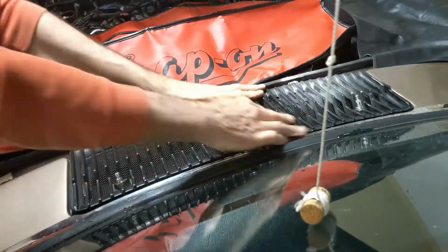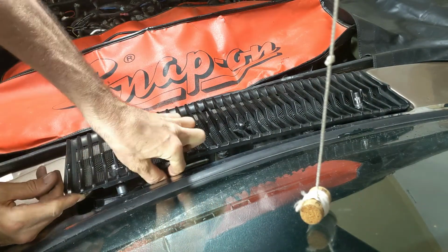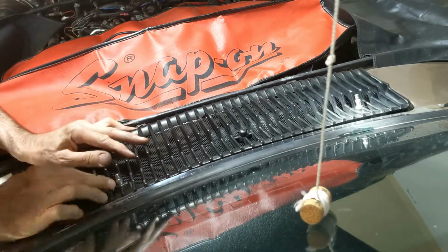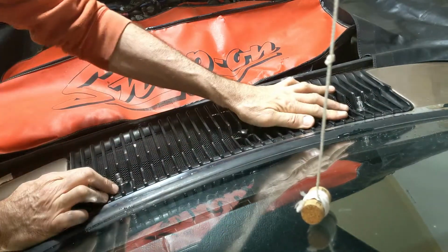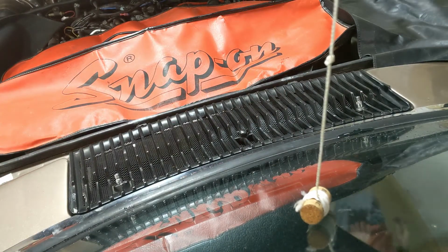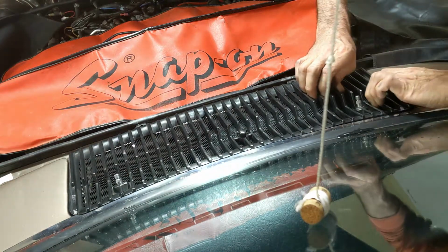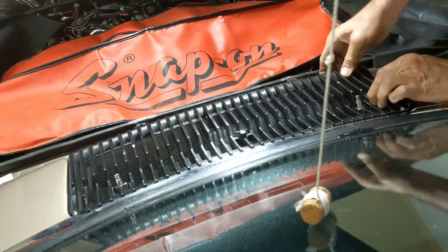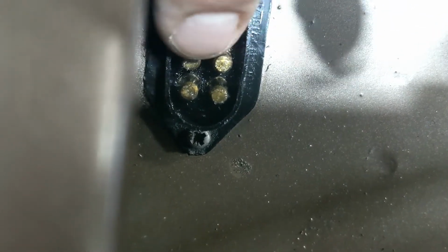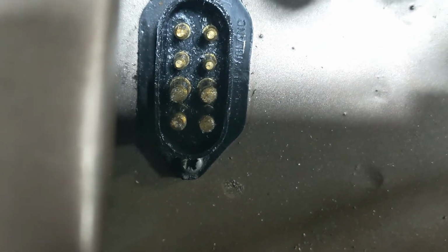There. Bloody hell. Oh, have I broken that thing? I've broken it. No, not completely. I think that would be fine. There. It's in. I think. This one's not quite on. I've got the wire wrapped around. It's this one and this one that should short, i.e. close between those two terminals in the off position, thus parking the blades, and that doesn't happen on mine,